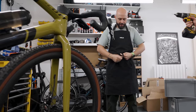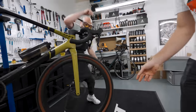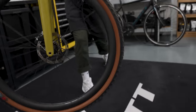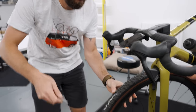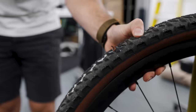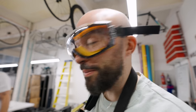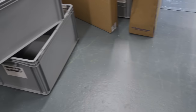Are you ready, Jimmy? Stand away — watch out! In this case, you'd use this tool to make the hole bigger. Then you load a plug, hold it from side to side, and pull it out. The pressure's still in there — spin it, and the sealant will just seal around the plug. I can't believe that actually worked so well. We didn't even make very much mess. The tool works perfectly fine — it's a good tool.